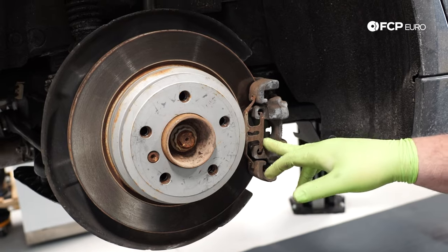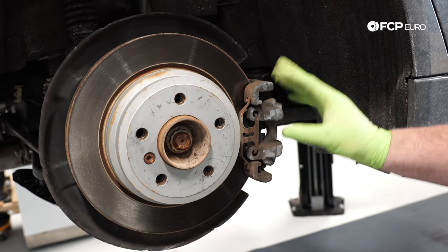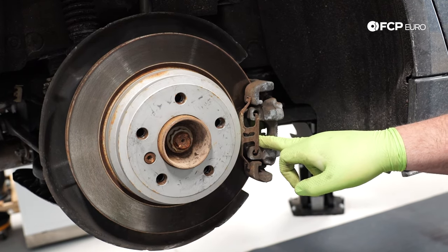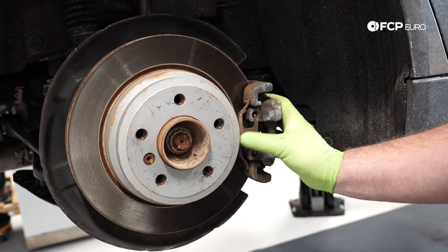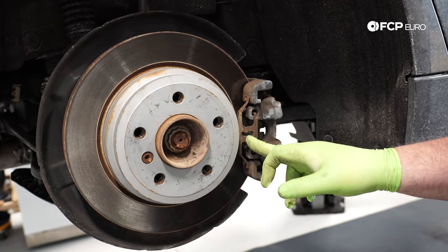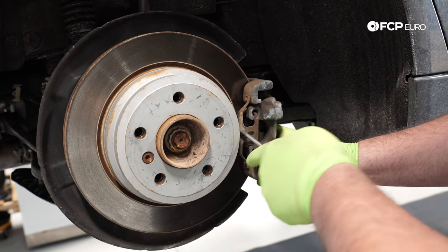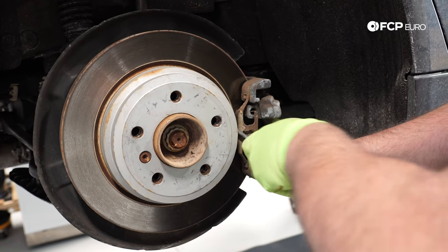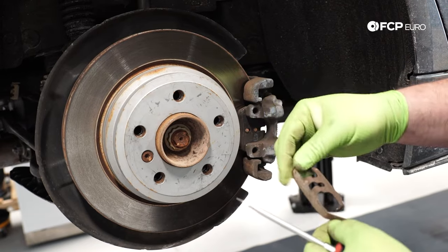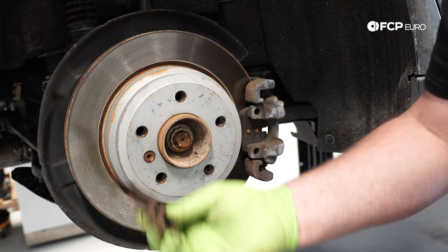We have a really in-depth tech tip video on how to remove these anti-rattle clips, but basically it's just a spring-loaded mechanism to hold the brake caliper to the outboard pad — basically preventing the outboard pad from making a rattling noise, hence the anti-rattle clip. Some of them you can squeeze in with your hands, but on a lot of the F chassis cars these have quite a bit of spring. Just come in here with a flathead screwdriver between the rotor and the clip, push back in the center only — don't pry from the ears. Once you get the ears out from the two holes on the caliper, it comes off, no drama, no fuss.